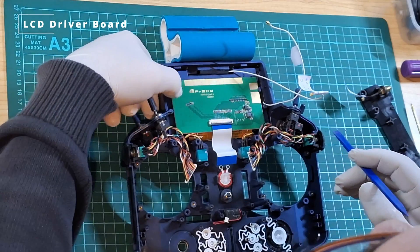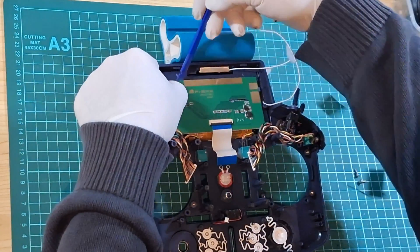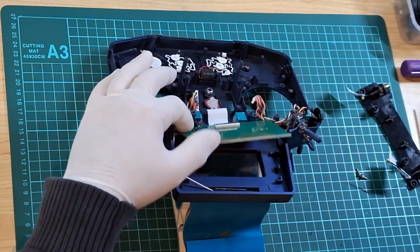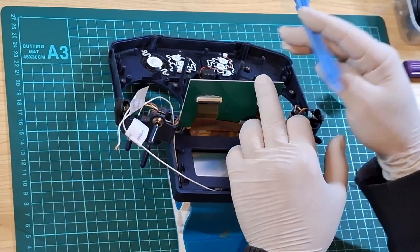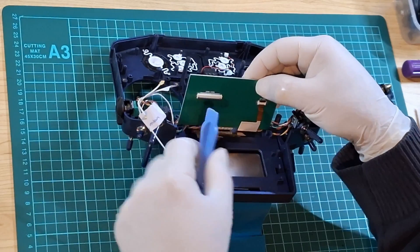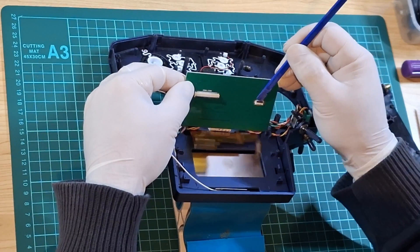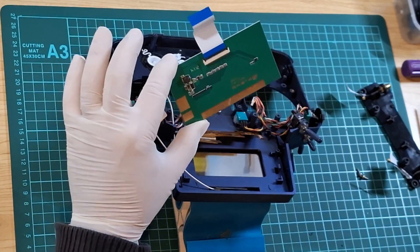The final logic board left is the LCD driver board, and that is held down by two tabs. Gently pull on the left tab and gently pull up with your spudger on the upper left side of the board. Don't try to remove the LCD driver board yet — turn the transmitter over and lift the LCD driver board up to reveal the LCD and digitizer flex cables. With a spudger tool, gently pull back on the tab of the LCD and then the digitizer flex cables to free and remove the two flex cables. Once removed, you are free to remove the LCD driver board.